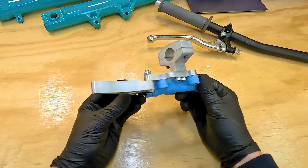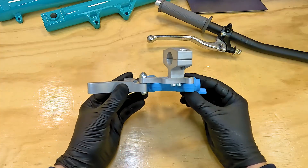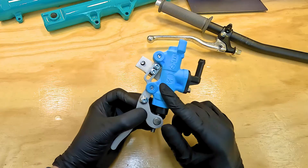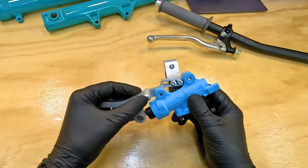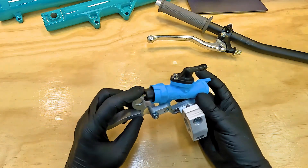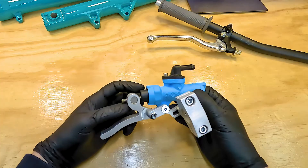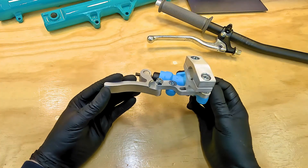Another trick part I got for the bike is this thumb brake, made for me by HWW Racing - I'll leave a link in the description to where you can buy these. What's really cool is they've managed to get it working with the standard rear master cylinders. It's just a case of undoing two bolts and bolting it to the thumb brake. You do have to change one part to make it work, but it's fairly easy - especially whilst rebuilding the master cylinder at the same time. Hopefully being a hand-operated brake, I might get more feel and it might improve my riding style.